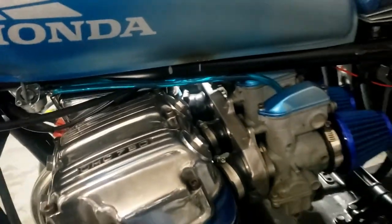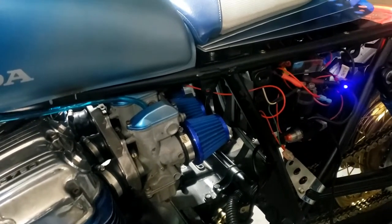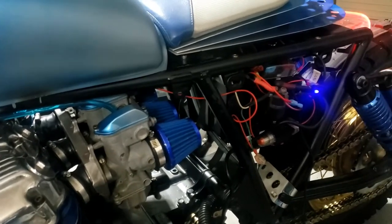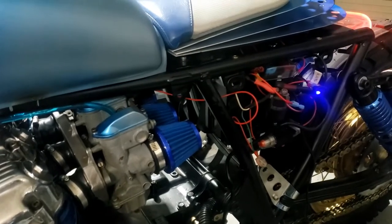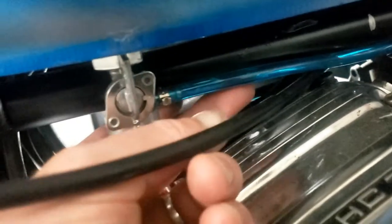I've kind of semi-rectified that — we're obviously going to have to adjust it so this pipe comes downhill the whole way. I've been cranking it and just got a little sign of life — it's trying. Now we're running out of battery. A few little pops and farts, encouraging as they were, and now we've got a dead battery. Let's let that charge up overnight and resume in the morning. I'll leave the fuel on so hopefully more will get down there. You can see the problem — it went up in a loop and it needs to go downhill the whole way.